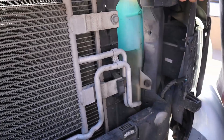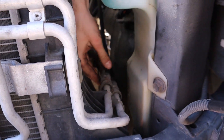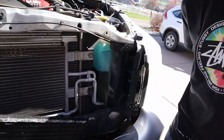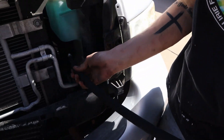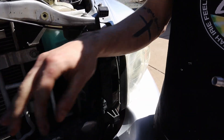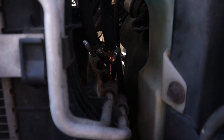So with the new transmission cooler from Mishimoto, you do have to come in here and cut these rubber hoses right here. Mishimoto says come about five inches back from the hump, so probably somewhere right in there. They give you some new lines and some ends. These will feed into your transmission cooler. We're gonna cut those off, seal them up, pull this out, and pull the radiator out. We got those cut, got the nipples ready so we can plug it off pretty quick and just have these hoses coming out the top here until we get everything else out.